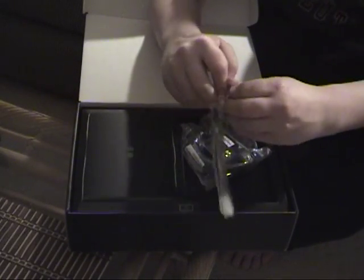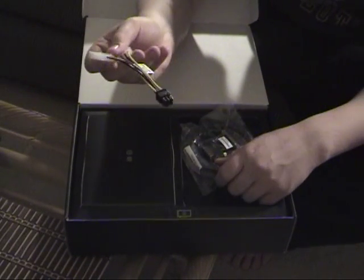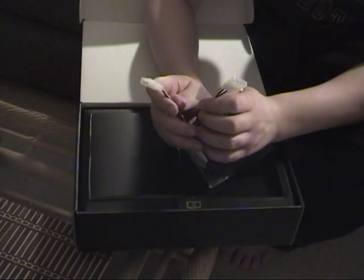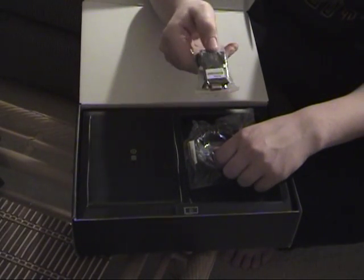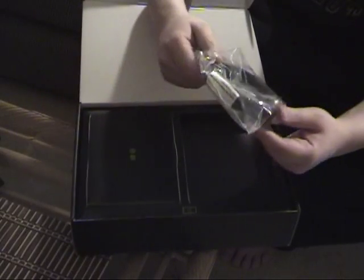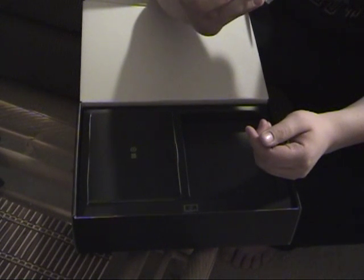This is just for power — it's really easy. I can tell already it's going to be really easy to hook up. Just plug that in to this; this end will go to the video card and these will come from your power supply. This is just an adapter which probably most people don't need anymore, especially if you have this kind of video card. This adapter you probably will need — it's a mini HDMI to a regular HDMI cord, which will be really nice.